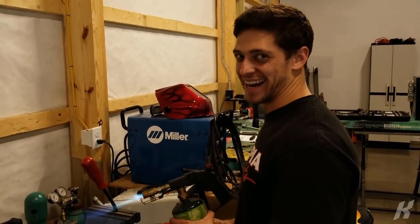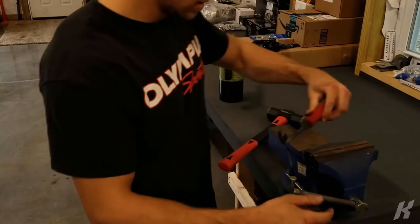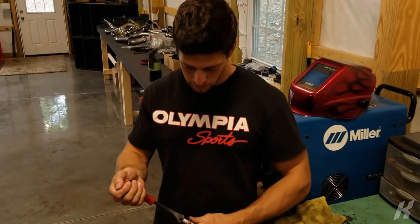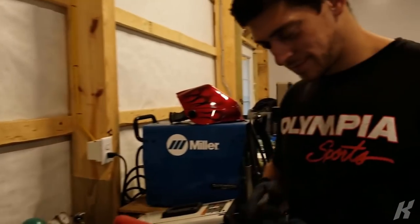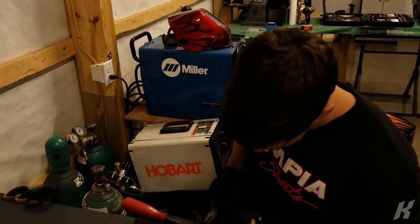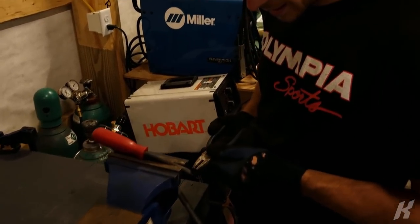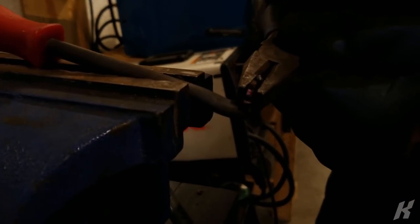Trying to get a spark plug out. So explain my great idea. Trying to stick this in there. Grab it right on there and pull out, because it's stuck. So we're on to making a tool V3. V3? What do we decide on? We're going to cut it and weld it at a 90 so it's small enough to fit in the well for the spark plug.